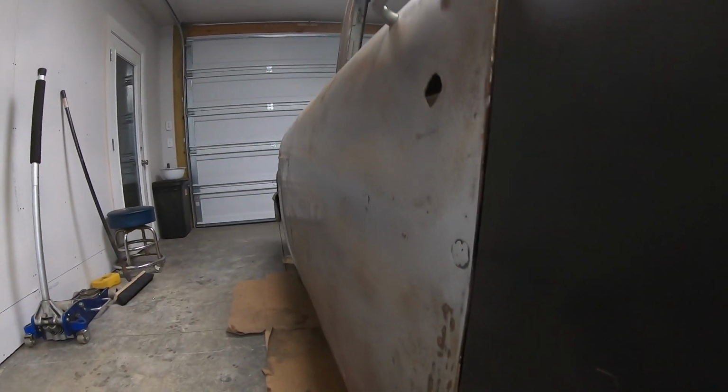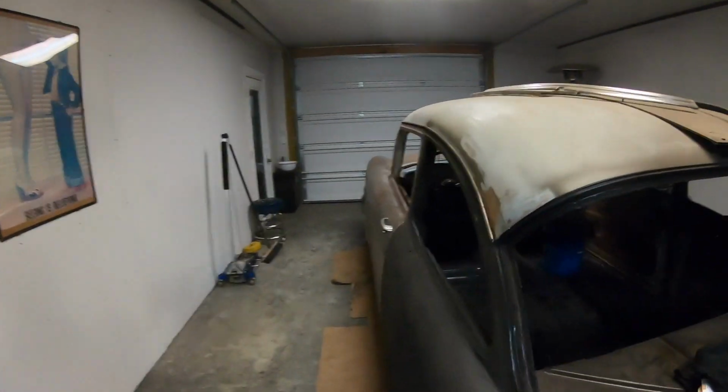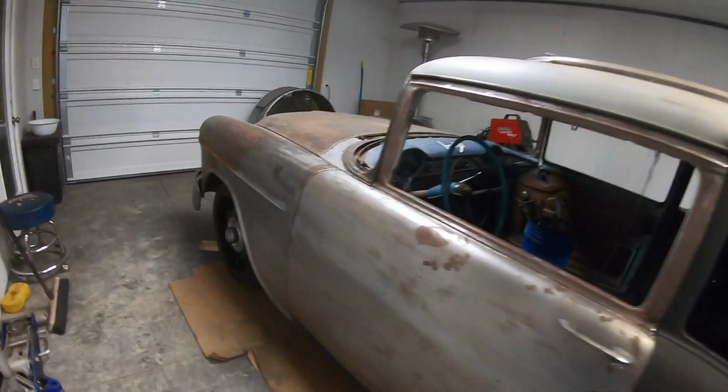As you guys can see down through there, with throwing the heat on it. But the only reason it was able to stay straight is because I was cooling. If you just throw a bunch of heat on there, welding them holes up, stuff like that, your door's going to go every which way. So it takes time, all that good stuff. Take your time with this if this is something you have to do on your project.